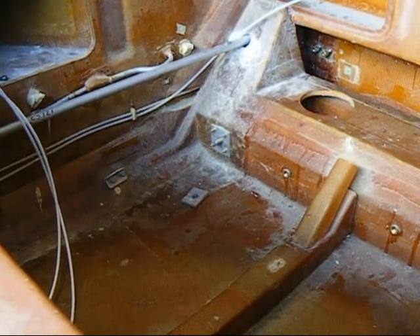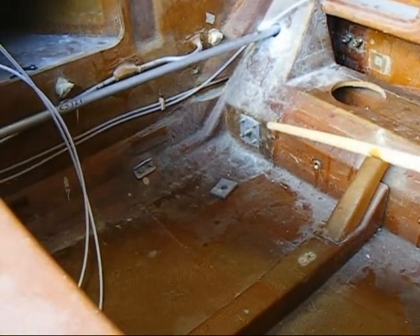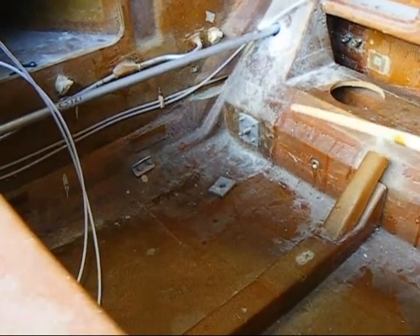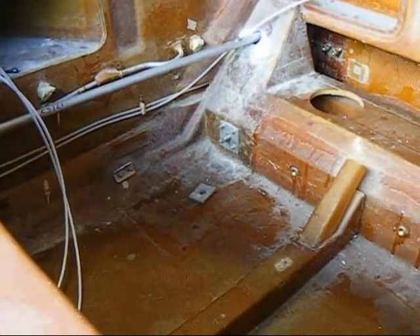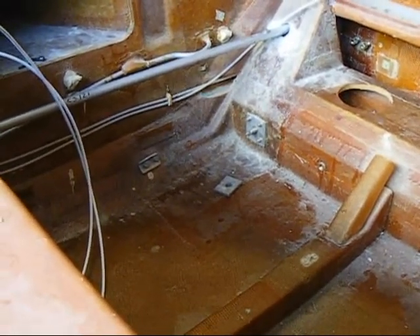The reason I needed to drop the bow was to get at the 16 machine screws. There are four here, four on the opposite side, then four in the back landing gear bulkhead. Those 16 screws had to be replaced. In order to get those, as we'll see in a minute, the bow had to come down to provide enough clearance to get them out.